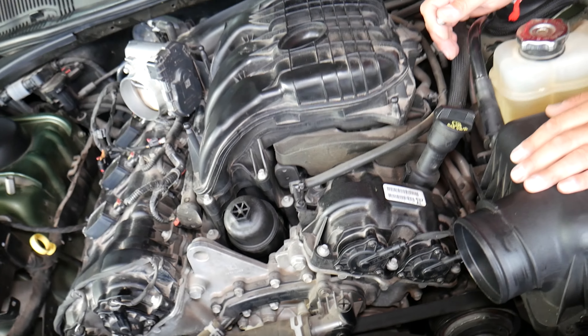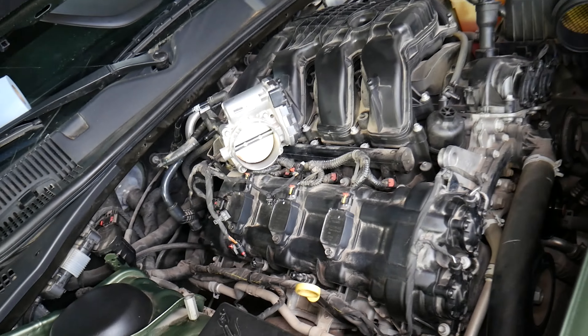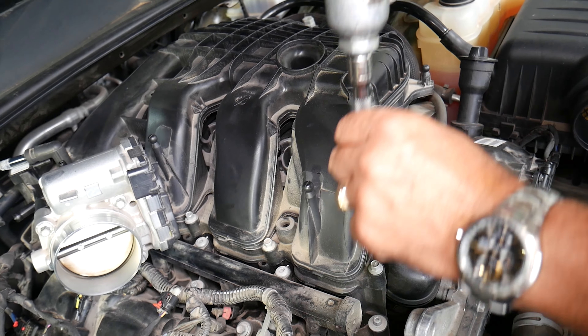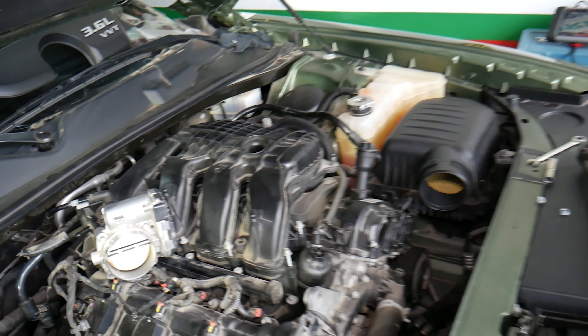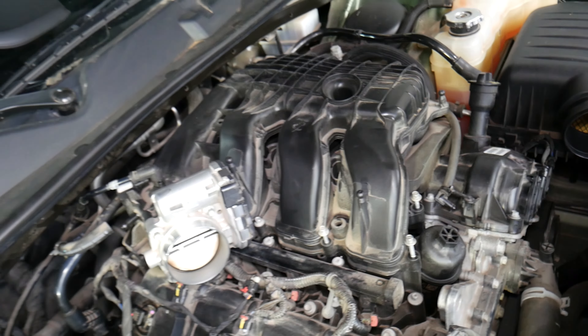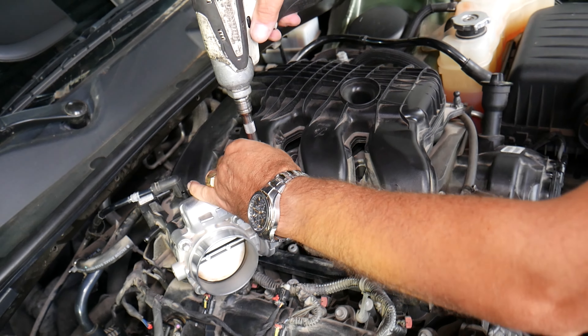We have a link where you can buy a new oil cooler. You can check out the video on the Pentastar 3.6 engine — this is known as the Pentastar engine. We should be ready on this side now. We're going to start with 8mm and start pre-loosening some bolts. We need to get a longer extension because we don't want to risk damaging the intake manifold.